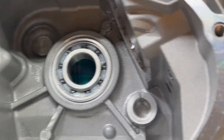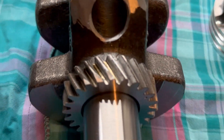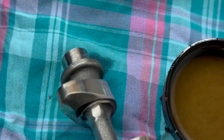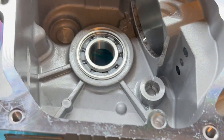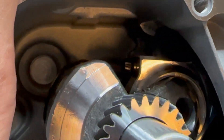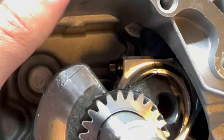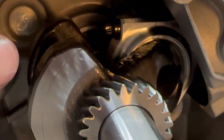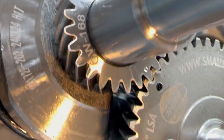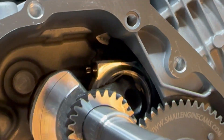This is what it looks like after I drilled it out, so it doesn't build up so much pressure. Now that everything's cleaned up and all the clearance is done — crank, cam — we're ready for final assembly. Got the rings on the piston, installed the piston and rod. About to torque down the rod bolts with a torque sequence: 60 all the way to 170, in 20 inch-pound increments at a time. Got the lifters and cam in there, and just about ready to put the side cover back on and torque it down.